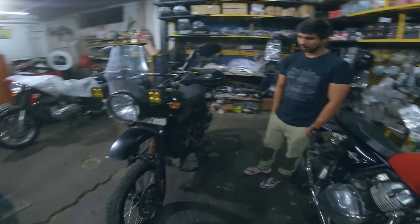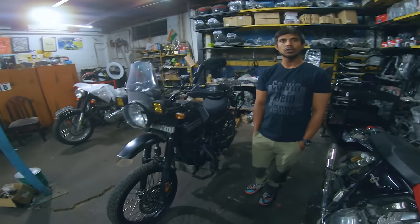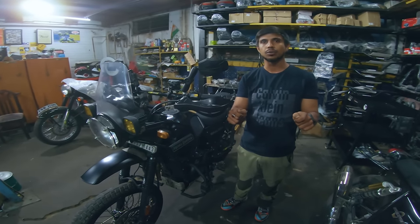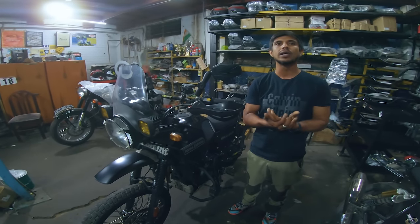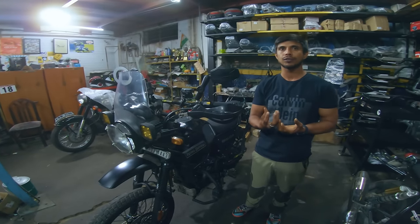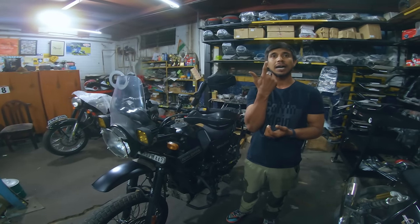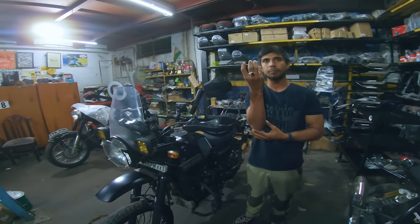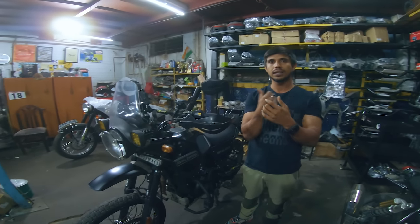Okay. So when I brought the bike in, what was the important issue that you found on my bike? See, mostly the maneuvering was not easy on this motorcycle. When I'm riding it straight, it is very smooth. When I'm trying to rotate right and left, maneuvering was not smooth. It was holding up. So that was due to the bearings, is it? Bearings. Like in the earlier part which I have shown, there was no lubricant on the bearing. And also the bearing had left marks on the ring. The roller bearings have given that impact on the ring, so it was holding up. It doesn't have that free movement. So that is the reason it is replaced now.